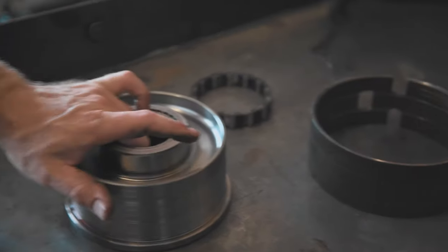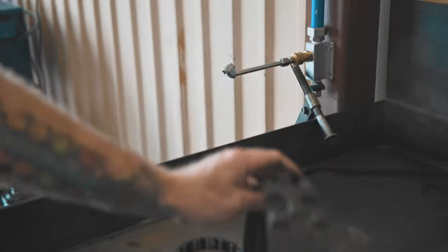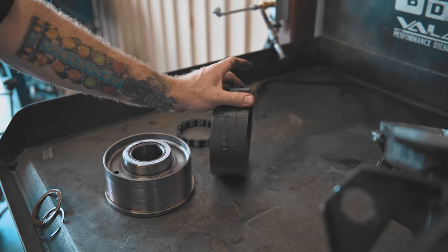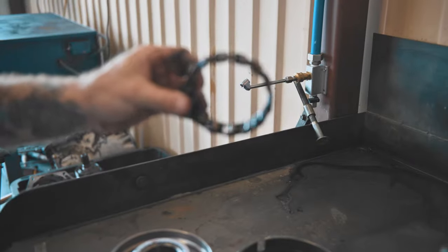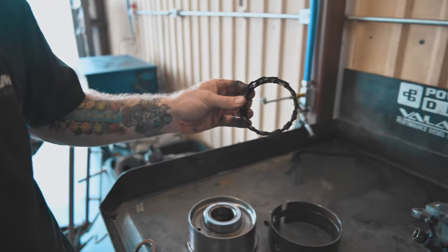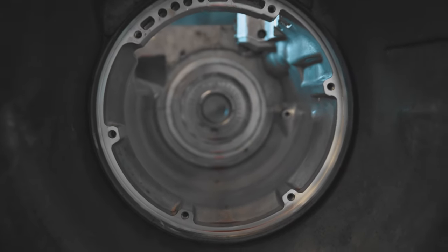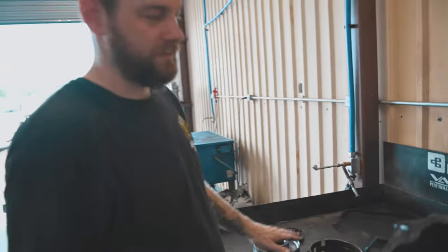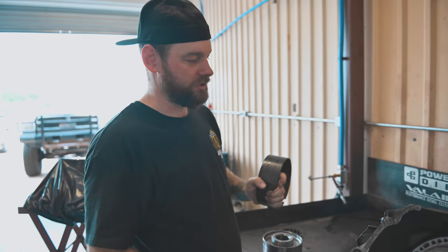So what do we have here? Got the lower reverse drum thing, lower reverse band. This comes on in manual one and reverse. And then this is the one-way roller sprag that blows apart - it goes in the very bottom. So if you leave really, really hard in D, you can break that. You can overpower that. That's why everybody goes full manual valve body, because it applies the lower reverse band in manual one which holds the drum. So you're not only just pushing on the sprag, you're also pushing on the lower reverse band.